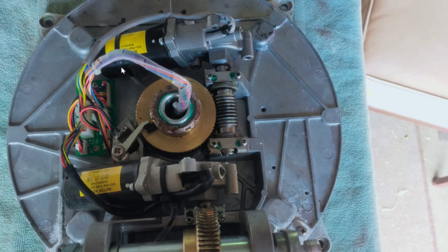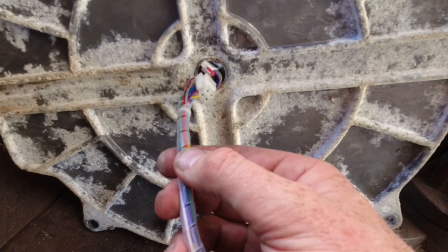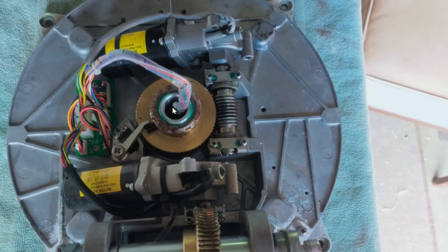Remove this limit switch and also this arm. I did snip the cable tie here because you're going to have to remove this motor with the worm drive — the cable tie stops the motor from lifting when it turns. Make sure to reinstall cable ties on these motors so they don't lift when they operate. The next thing to do is find the plugs for these cables and gently feed them back down the shaft — you want to remove the cables so they're not protruding up through the shaft because we're going to apply some heat to this nut. Turn them 90 degrees and gently feed them down through the shaft — it will fit.